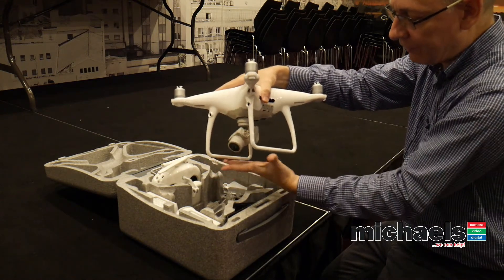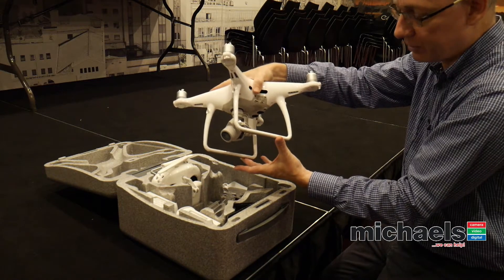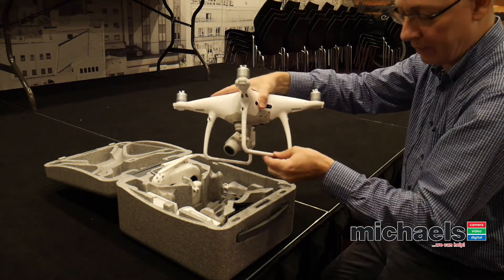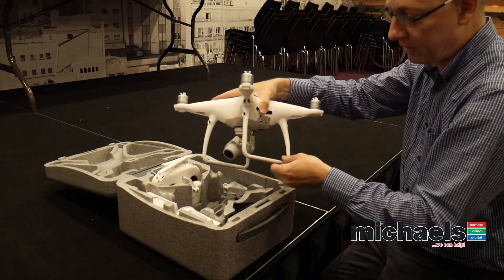Once I've removed this little gimbal holder, the gimbal is kind of floppy — it's electrically powered with little motors in here, so once the drone is powered up you'll see the gimbal start to do things. Otherwise it's fragile — you don't want to hit it. If you crash your drone and the camera and gimbal take a hit you could bend those little arms — I've seen some damaged ones come into the store. The feet or legs of the drone take care of most minor impact, but a full-on crash will probably destroy the camera.